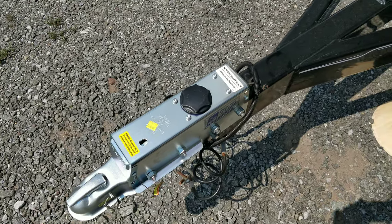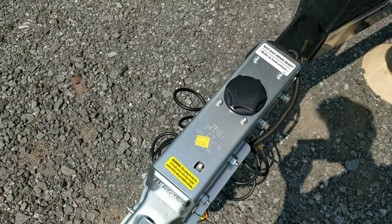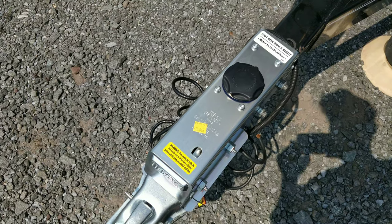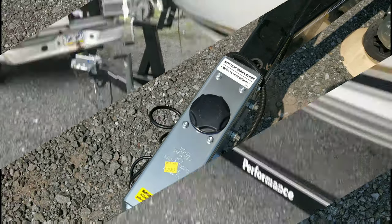So guys, I got the tongue all attached. I got the line all screwed in. I had to pull it a little tighter. I had to bend it a little bit. I made sure that, well, it doesn't look like it's gonna rub on any metal. So apparently this master cylinder's in just a little bit farther. But I get this done, and then tomorrow we'll just torque down.